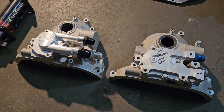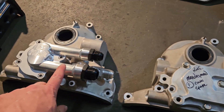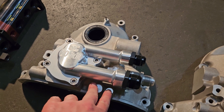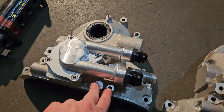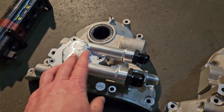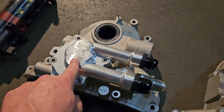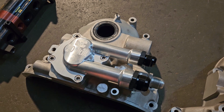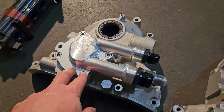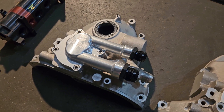The rotary world is ever-evolving and we've got one of the classic Mazda dry sump setups here. I was just able to get my hands on one of Chip Ursue's modified front covers. If you're looking at getting anything through Chip now, you'd probably end up going with one of the full billet front covers — super nice. This one is 20 millimeters, which would be the high volume, or even slightly higher volume than what the factory ones were putting out, even in their best form. He also has a bigger volume one available for multi-rotor — four rotors, six rotors, things like that.